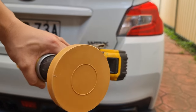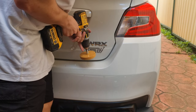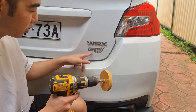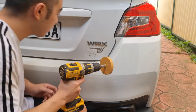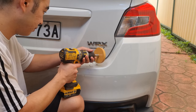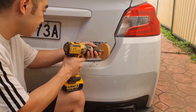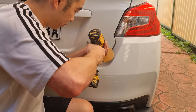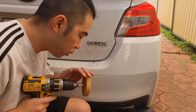So this thing is really simple — it's like a giant rubber eraser. You just do it at low speed so that it doesn't burn the paint. This is already so much easier to use than I'd expected — I already got that much off. With this part of the project, you also want to control the speed of the drill and the force you apply to the paint. If either the speed or force applied is too great, you could end up burning through your clear coat, and then you've got a problem on your hands.